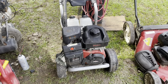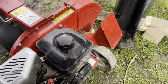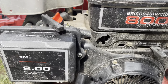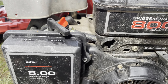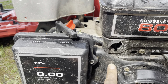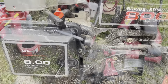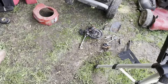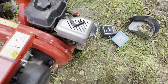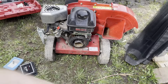And that's a 9 horsepower. This is an 8 horsepower, same motor, same style of build, just smaller cylinder. So theoretically, that stator lives here. I can transfer that over to there. Don't really want to do that. So we know this one's all taken apart. There's 2 coils down there. Those are ignition coils, not stators. Stators, coils, alternators, all kind of the same thing along the same platform. Again, took it off this unit, which we know runs.